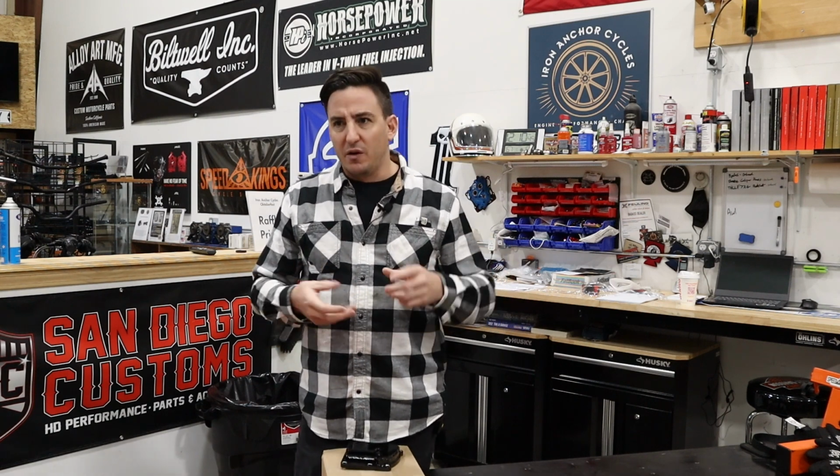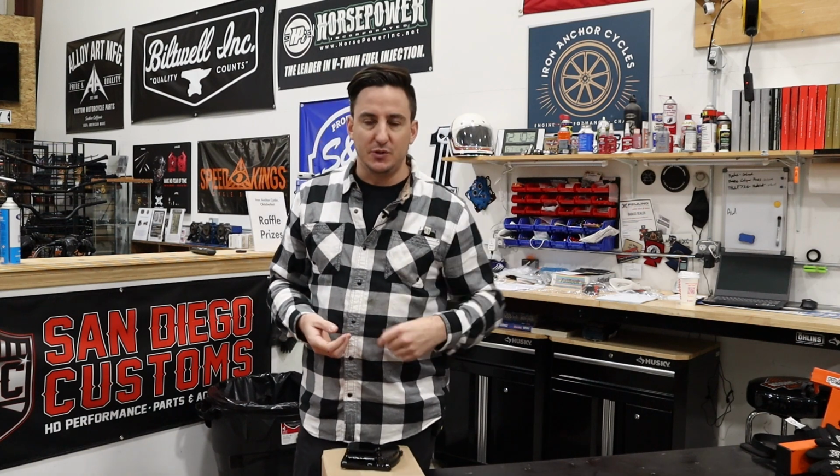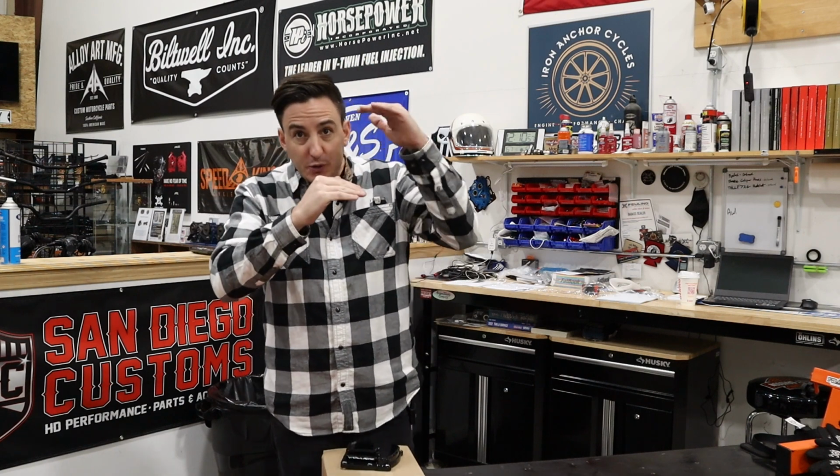So the vented dipstick option or a vented oil cap option, there are some that just use a cap as opposed to a dipstick, that works. However, it presents some challenges, most notably that your oil is very close to your oil dipstick. So the likelihood of you getting some oil that comes out through there and gets out of the motor and goes through and into your filter and clogs that is possible.